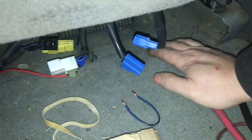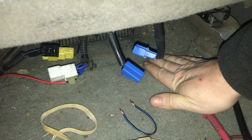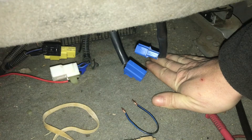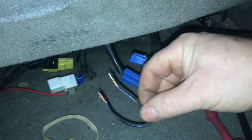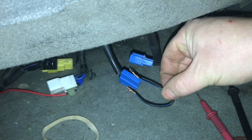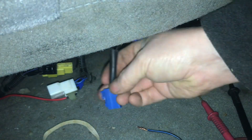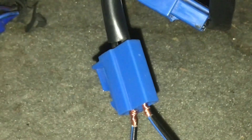The way this Kia is wired, normally you'd have two separate circuits - one safety circuit and one main heating circuit - but it looks like everything is just one continuous loop, kind of like Christmas tree lights in series. So we're putting this jumper wire in here to simulate the backrest heated element, and then we're going to check that the base - the part you sit on - is actually heating. Okay, that's plugged in, let's see if the seat gets hot.